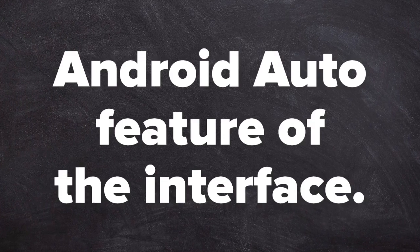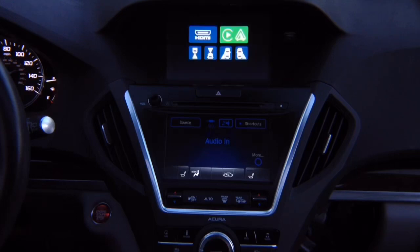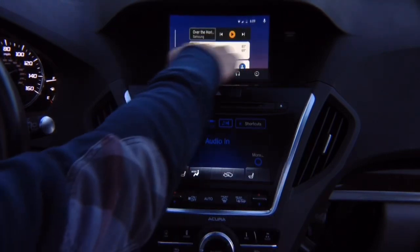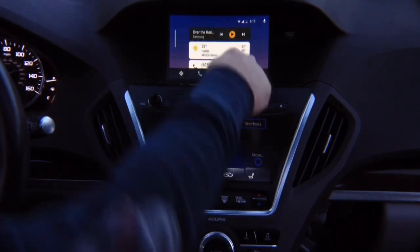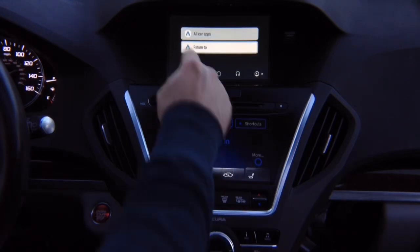Android Auto feature of the interface — now let's test Android Auto. Connect the Android phone, and once connected, Android Auto will come on the screen. Go into Android Auto and in a second it will appear. Now we have Android Auto — same thing, all controls are factory. You need to get into the menu on the bottom by pressing down. Navigate with the highlight: Maps, Calls, Main Menu to get out. Press enter and it's going to return to the factory screen.